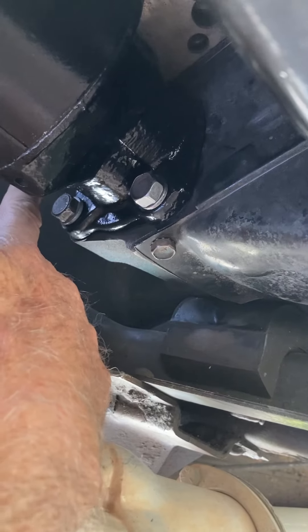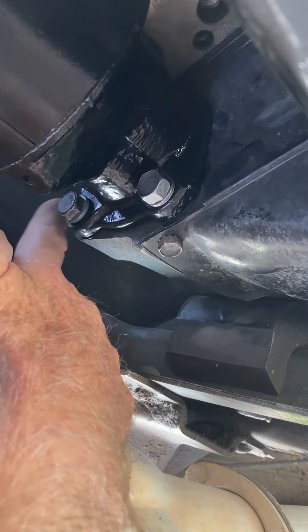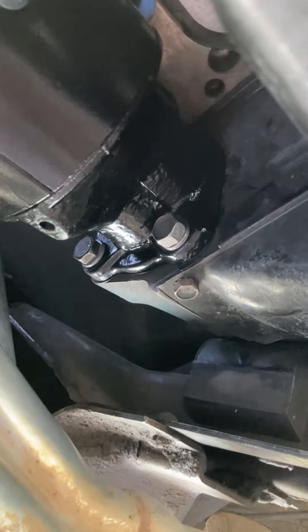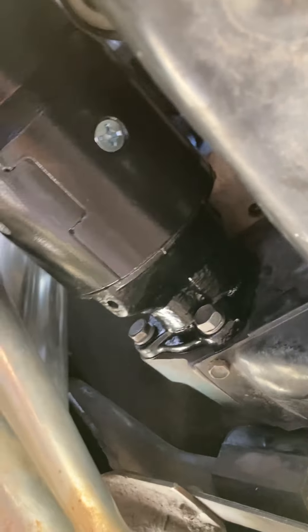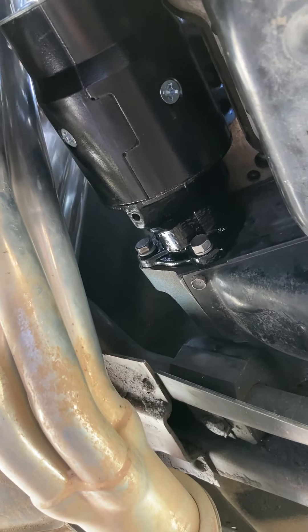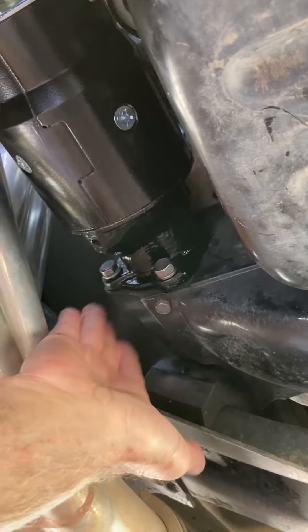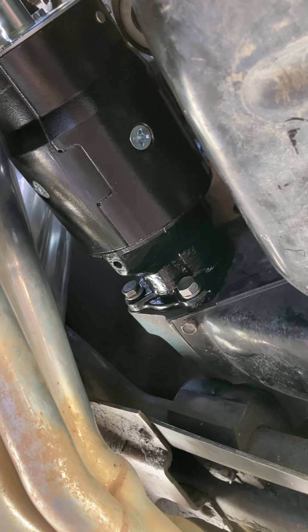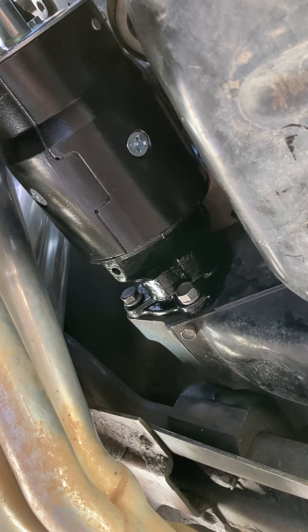There were just those two bolts, and there's a third bolt up on the top that's totally missing — it goes into the back there. So I was lucky the starter crapped out so I discovered that problem. There's a potential in the future I might need to replace the whole transmission because the bell housing hole is stripped. That's the fun thing about a 56-year-old pickup.